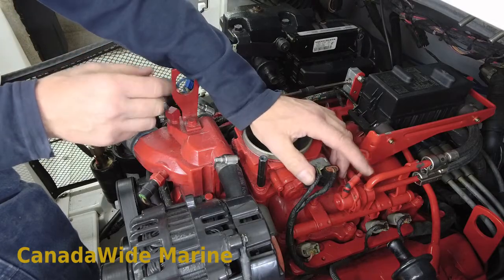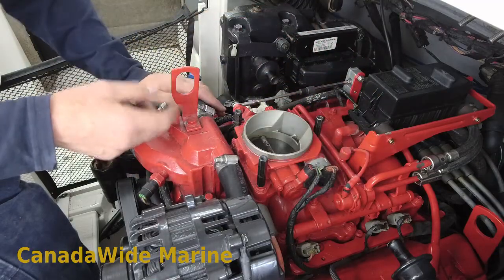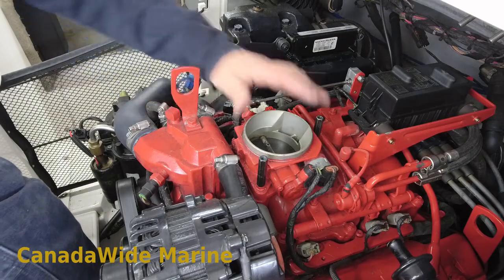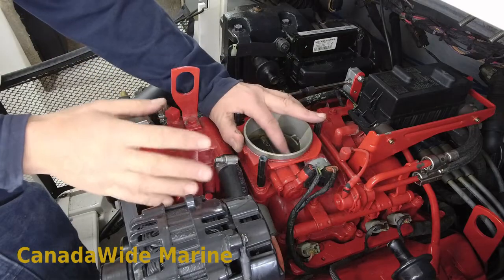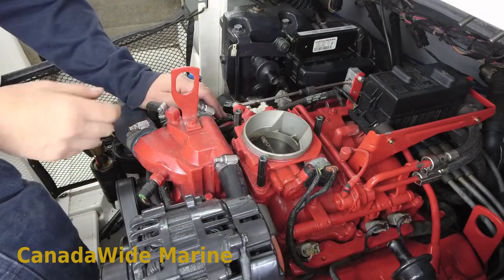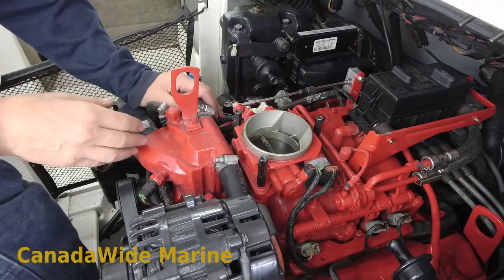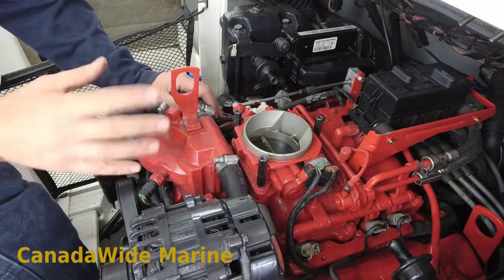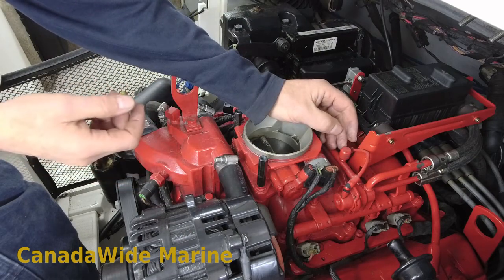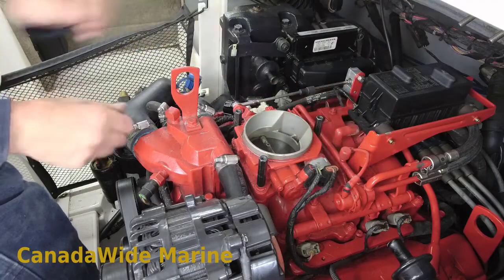So the fuel pressure gradually rises and that overloads your fuel pump, also causing a whine. I wanted to show you — it's actually really simple and quick to inspect and fix. This motor does not have a fuel pump whine; it runs just fine. I haven't checked fuel pressure on it — it's just here for service — but I wanted to take advantage of it while it was here. It doesn't hurt to have a look, and it will tell me what's going on since it is his original pump.